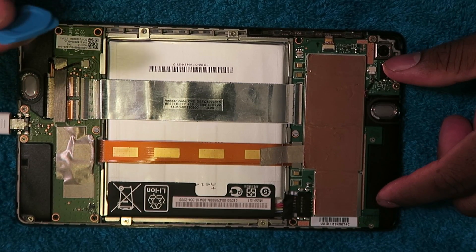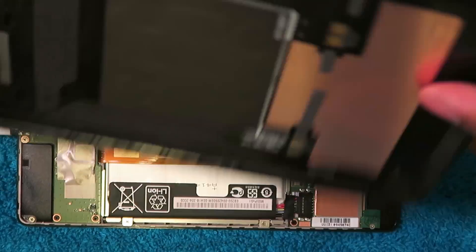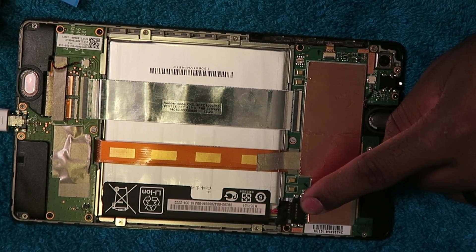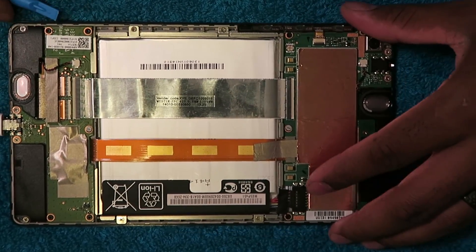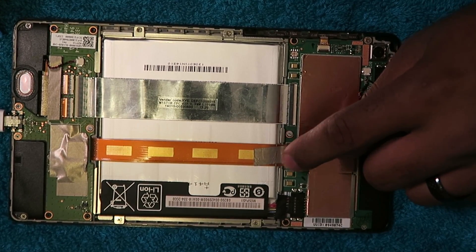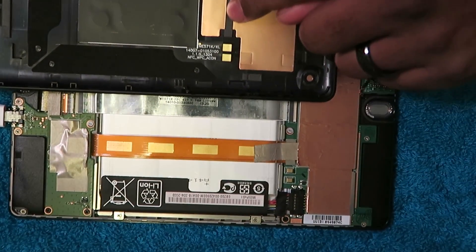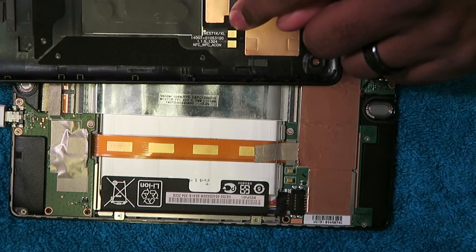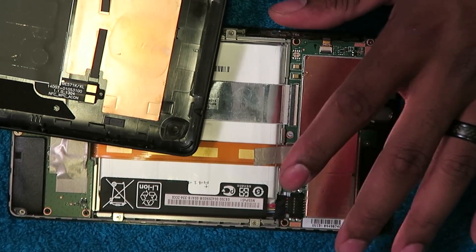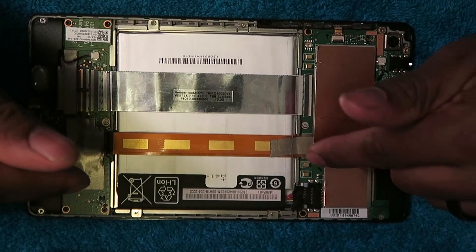Use something like this pry tool — any kind of pry tool will probably work, but this is a really sturdy one. Pop all four corners first so you don't end up putting a small crack in it like I did. Then try unplugging the battery and leaving the power off for five minutes — overkill, but let's be safe. If that doesn't work, take a look at that ribbon cable. I'm now seeing it's covered by a little spongy material, probably to help hold it in. Maybe ASUS added that knowing it could come off from impact — and sometimes if the impact is great enough it'll still pop off.